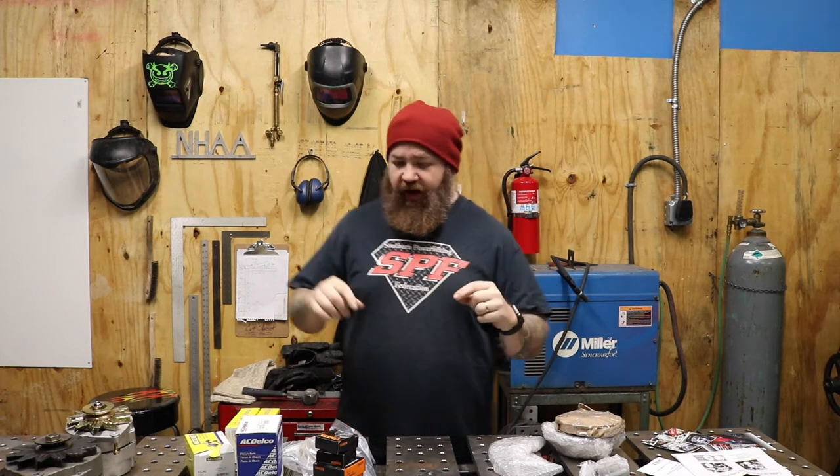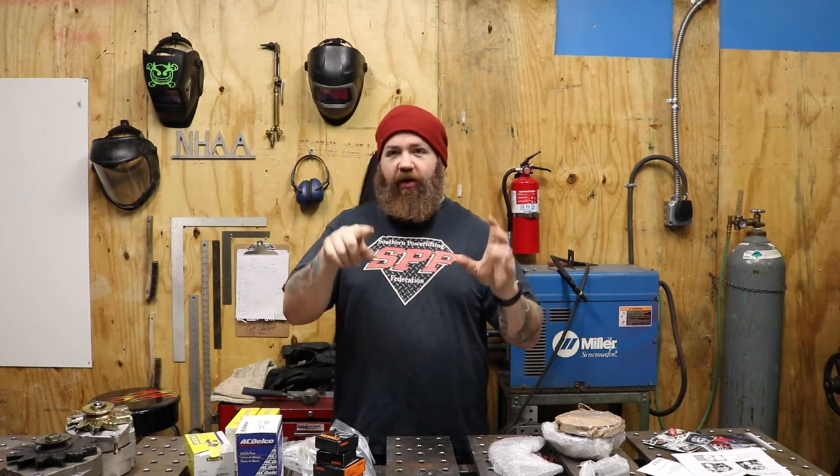They sent me — well, obviously I bought them — but a smog pulley delete kit and new alternator brackets. Let me explain real quick the way the smog pump and alternator work in a '72 Cadillac. The belt goes crank, smog pump, water pump — that powers the water pump and the smog pump, and you use the smog pump to create tension for the water pump. Then there's a second pulley on the water pump that goes straight to the alternator.